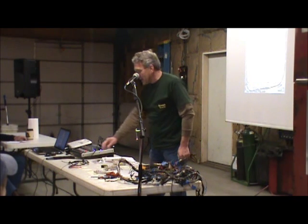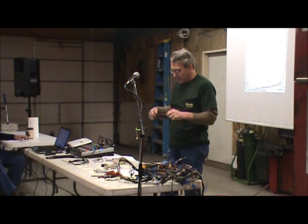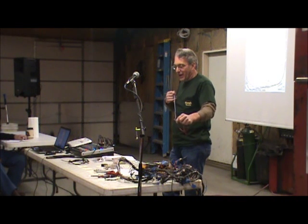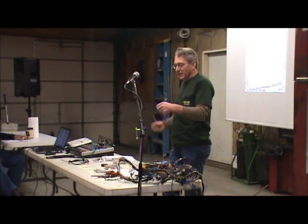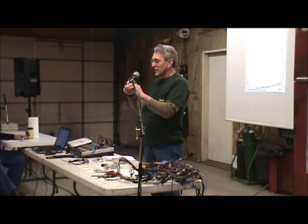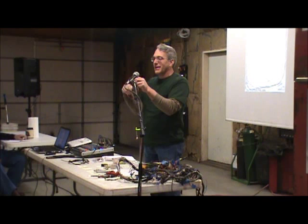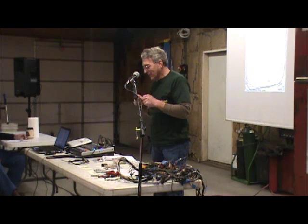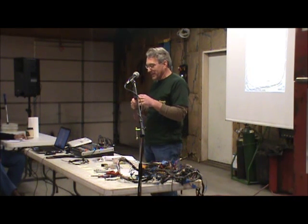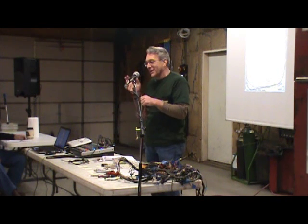The other one that kills me is splices. I worked on a car where this was done quite a bit. I thought, well, somebody's taken a lot of care, but they still ended up with junk. They took a razor blade, scored around this wire, and stripped off a little section about that big, and then wrapped the splice around it, and then just taped it up. That was the splice. Okay, well, it's pretty strong, I'll give it that, but you still have the same problems as you did with the other junk. You really didn't seal it, you didn't make a good mechanical and electrical connection, you just wrapped a wire around there and kind of taped it off.